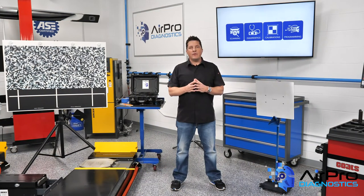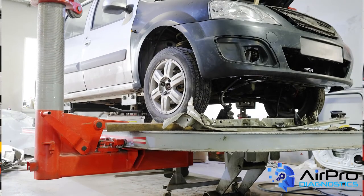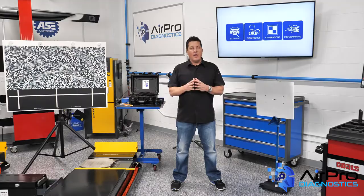What about structural realignment? Should any aluminum structural part on an aluminum vehicle or a mixed material structure be pulled out on a frame machine? It should be unanchored pulling only, using only the weight of the vehicle. Anything more than this can risk separation of unseen, unnoticed internal bonded panels and adhesives that could result in additional problems down the road, such as squeaks, rattles, and the risk of creating structural strength and safety issues, which could be irreversible or unrepairable.